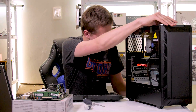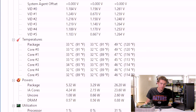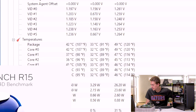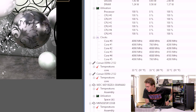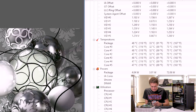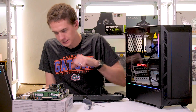This won't have RGB, so it's a bit disappointing, but there we go — fan spinning. We're idling about 33 degrees. We've already hit 50 degrees from boot up, so that's not exactly confidence-inspiring. Running Cinebench, we're at 70°C already and just continuing to climb. No thermal slowdown — still at 4.1 gigahertz. We peaked at 75°C on the package, which is fine, but that was just about a minute of running Cinebench.